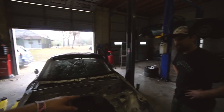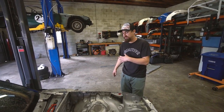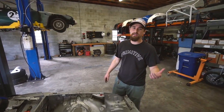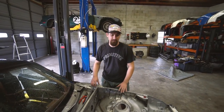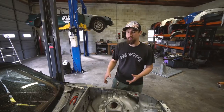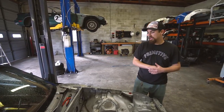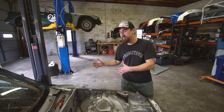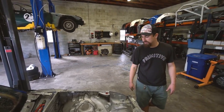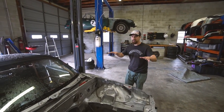We want to encourage everybody that even without perfect conditions or a paint booth, you can do this in a regular garage and it'll turn out fine — as long as you're not trying to build a 110% show car. The plan of attack: pressure wash first to remove initial grease, then sand so we're not sanding grease around, then wax and grease remover two or three times. As we wipe we'll notice missed spots, sand those down, use tack cloths to pick up dust, then spray the primer.